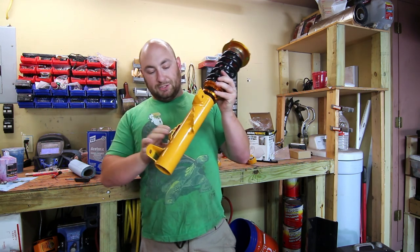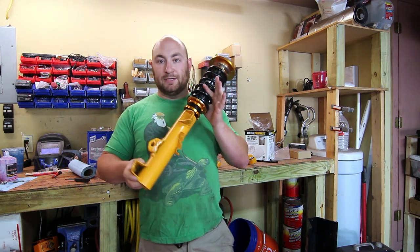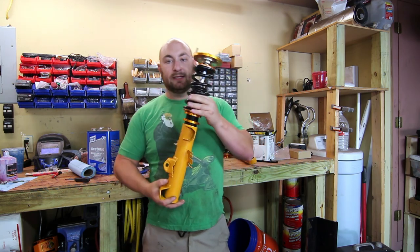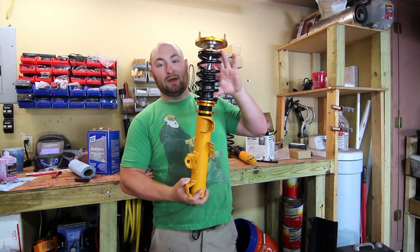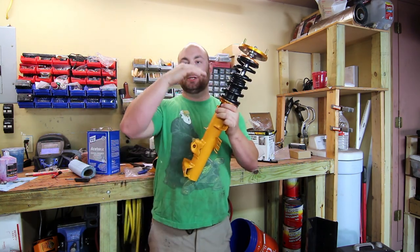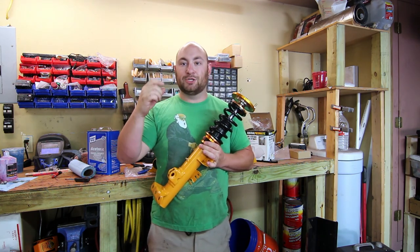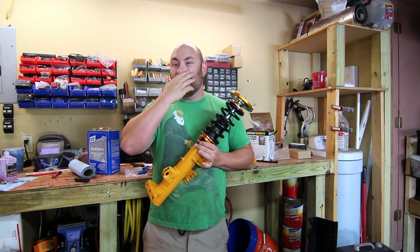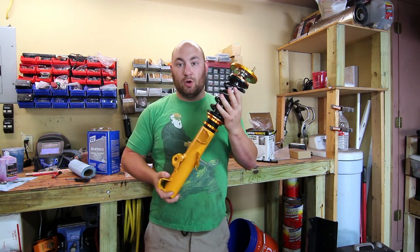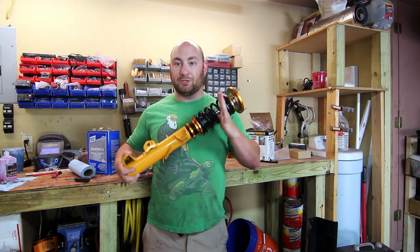While adjusting the bottom assembly makes it somewhat of a pain — you have to break all the bolts loose and do the whole suspension for major height adjustments — it's a really clever design because the shock travel always stays the same. The problem with a lot of lowering kits is you drop the spring and end up with a shock that can only move about half an inch, which blows it out and makes it ride like crap. This kit allows major height adjustment without destroying your shocks.